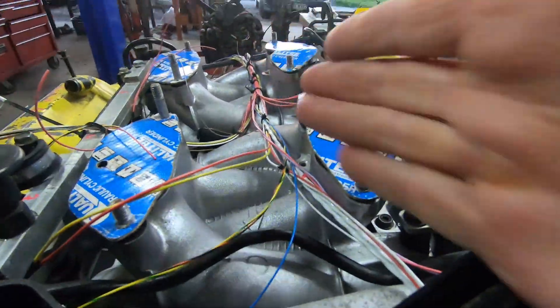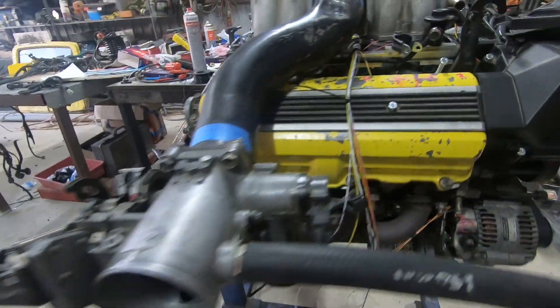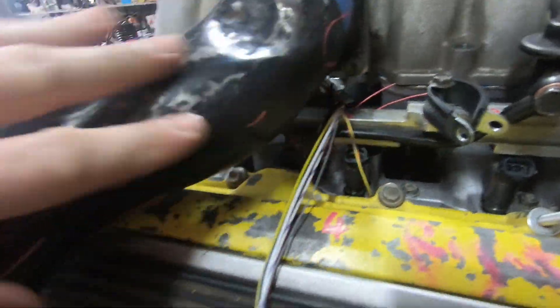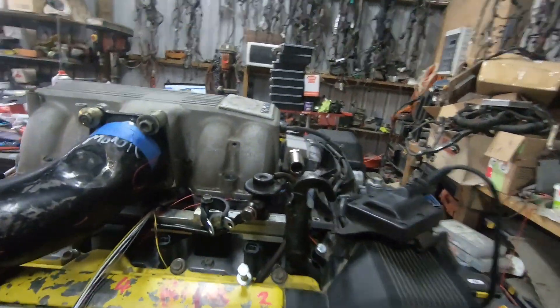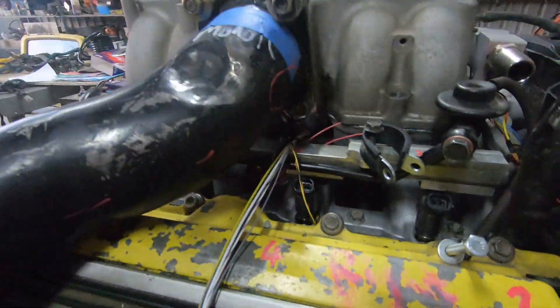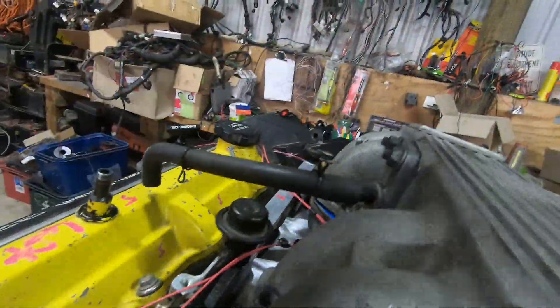Today's loom, being a Monsoon, I only get four injector drivers. I'm using the standard ignition — I'll have a quick chat about the igniters in a separate video. It's a pretty simple loom. I've chosen to come through the middle because the throttle body is out here, and that means it's just going to be easier to flow my wires out. The igniter is out by the throttle body, so I don't have to bring coil wiring around the back, around here, down that side, and down to the front coil.